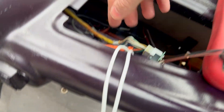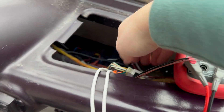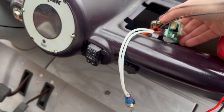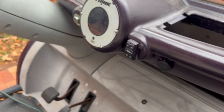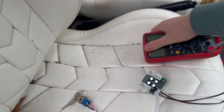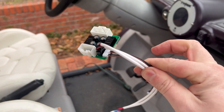If you plug the low side in, how this bypass works is when you turn the key on, it also closes that relay that we manually activated earlier. This is a full bypass that gives you 12 volts and everything, and includes turn signal lights as well. Hopefully that helps some of you debug your first issues with your cart. If it does, feel free to like and subscribe. If you need a way to bypass your cluster or something for debugging, these are available at fordthink.org. Thanks.